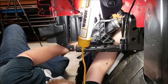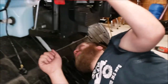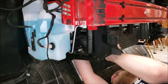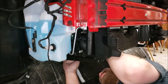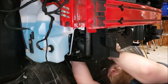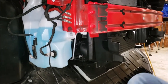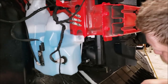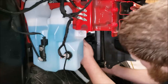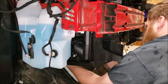Look at that. Gets on there perfectly. Alright. Okay. Yeah, I thought about getting the hard charge pipes. Is it similar to the ST and the RS where unless you're actually running a big turbo, they're useless? Yeah, pretty much. And they actually cause you to lose boost, because they are larger diameter. So yeah, if I was running an upgraded turbo.